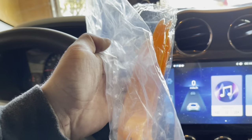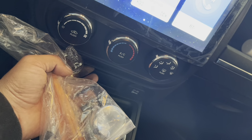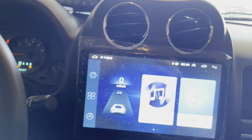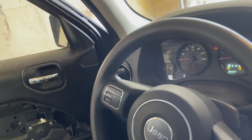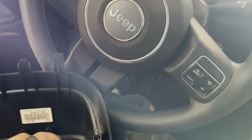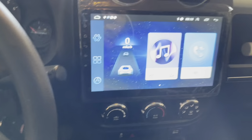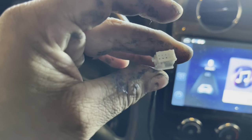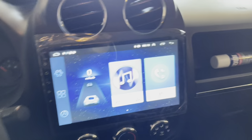Basically, yank the trim off — don't pull on these clips. It comes with tools; I'll put the link below to the one I bought. You just push up at the bottom, one pops off, and then once you get a little bit of leverage just pull it off with your hands and go all the way around. Everything is plug and play — connect everything where it needs to go. These connectors go in the white ports and only fit in one spot, so you can't mess that up.